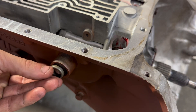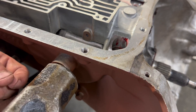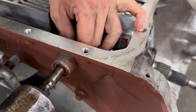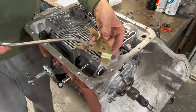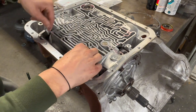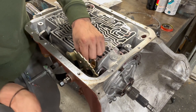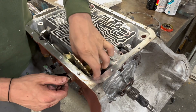This is a pretty crucial part here — if you don't change these out, they will leak. Hook faces toward your valve body, and your stem hooks right into the front like that. Walk that over, and your castle nut here — it's keyed one way. You can walk that — that's a 15mm.